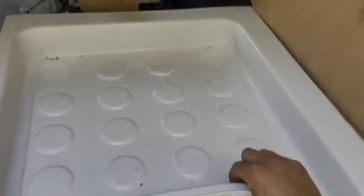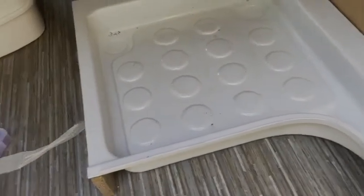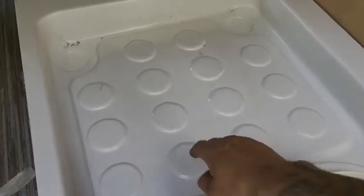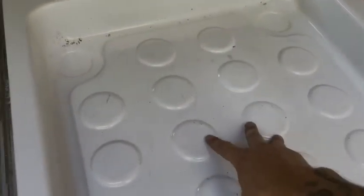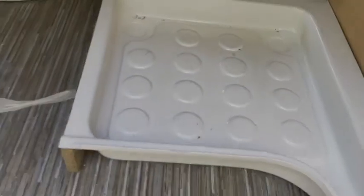there's a lot of flex in these. They will flex in and break over time, especially in cold weather. So you need to make sure, just put a piece of ply in there, and then we've just sikaflexed it down, and then that's going to take all this flex out of that, or the majority of it, and stop that breaking over time. The next job